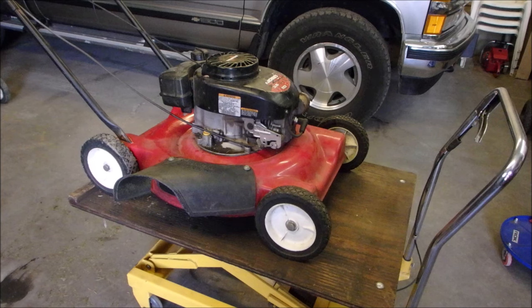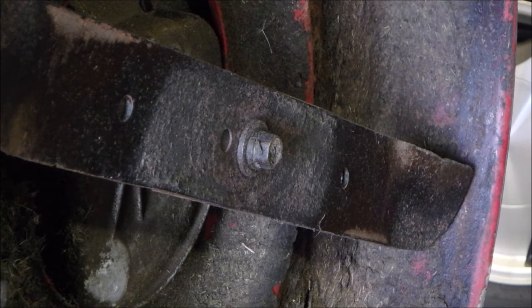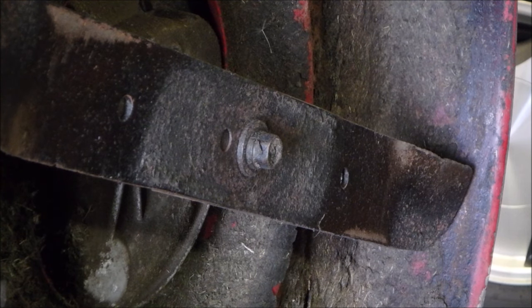And then I took the plug out, and the engine wouldn't rotate. So I took a ball peen hammer and tapped the blade with the plug out, of course. And I got some rotation. Okay, this blade has just been sticky, and I don't know what it is.